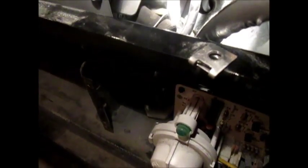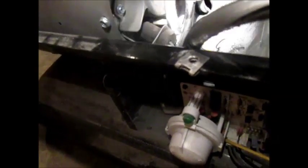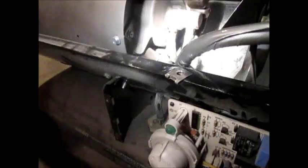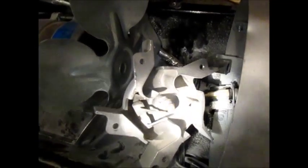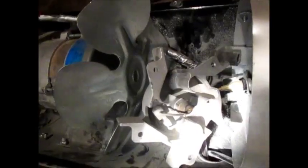That's our fuel line. That's gas. That line's actually a little cracked. I don't think that's necessarily stopping it from getting in. It's definitely a line that will need to be changed out eventually. My thought is maybe the igniter. Maybe there's some crud in the igniter or somewhere in this section. I know I'm getting spark. I can see spark when I started up and everything.